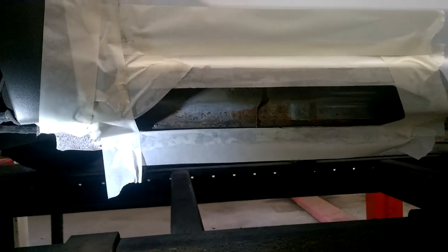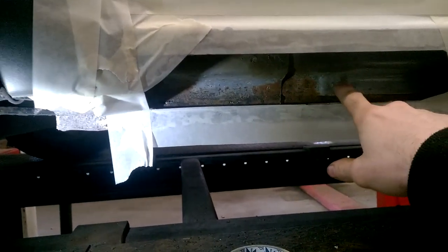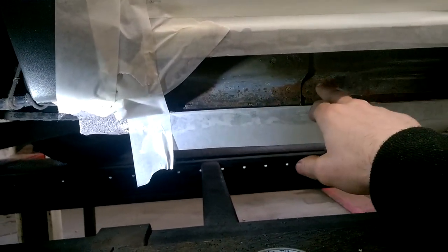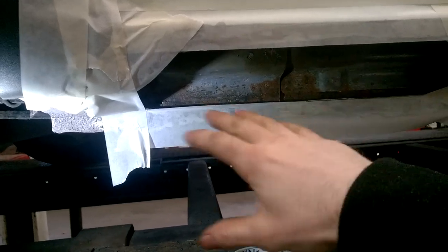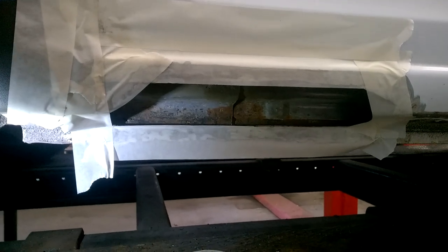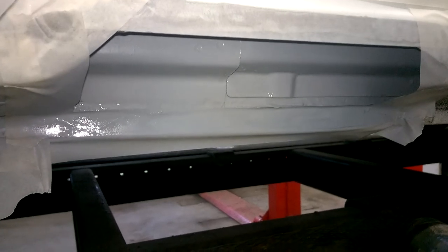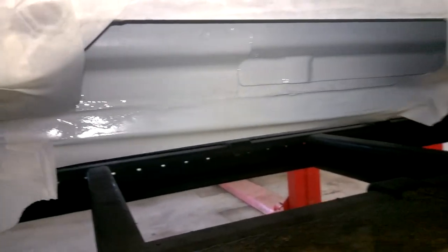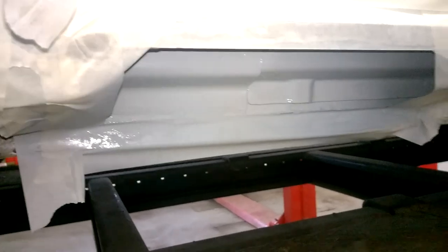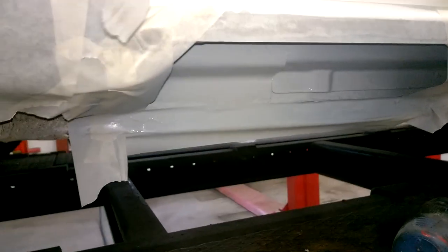The section is now masked off and ready for primer. It's cleaned up all in here — that's just surface rust — so I did a bit of sanding, blown out clean, and now it's ready for a good shot of primer inside in that area. Three coats of high-build fast-drying primer. Since I'm not doing this particular section in the oven, I just use the heat gun and a bit of infrared to help the drying process. Next step is to make the plate, which I've already started.